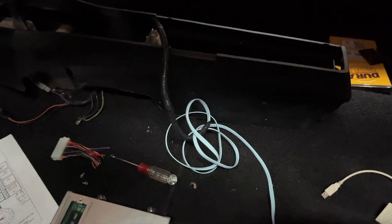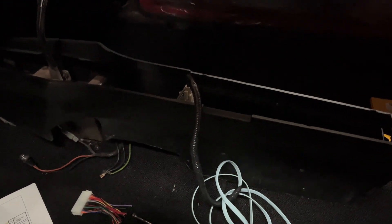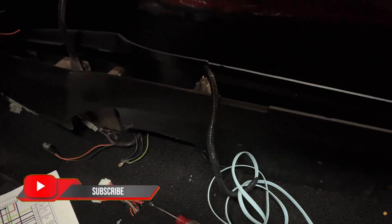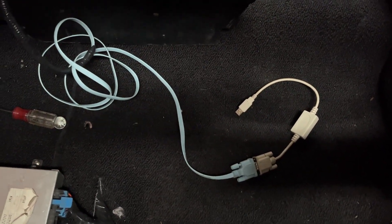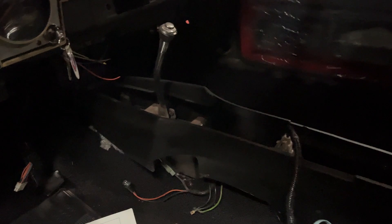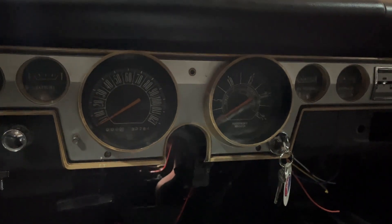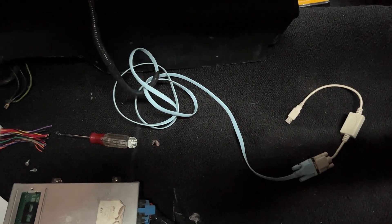Another thing is getting data out of the computer while driving. I have set up a connector mounted inside the console — there's a check engine light there and I have a jumper that tells me what codes might be. But I can connect the laptop to the computer while I'm driving and see certain shift points, fuel, and vacuum levels. That's why having a performance indicator vacuum gauge in one of these cars is very helpful — you can see where your vacuum's at and make note of it while you're watching the laptop, gather data, and tune the car later with the information you've gathered.